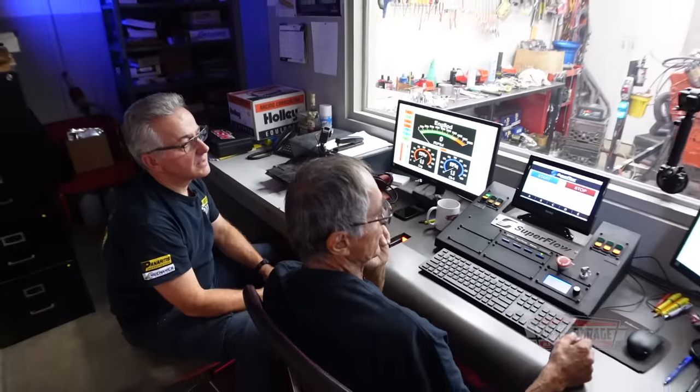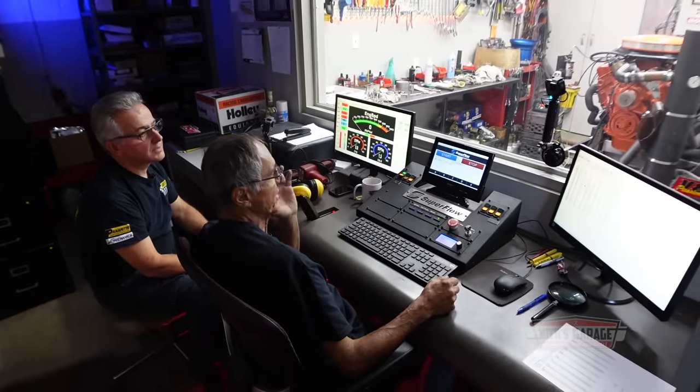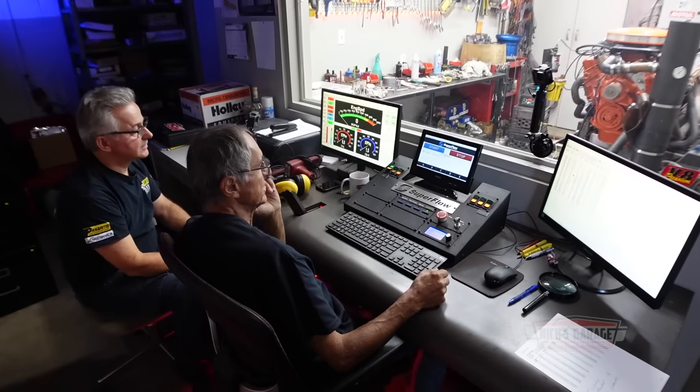And then we have the horsepower. By putting on that air cleaner, we're restricting it, right? Yes, we are. So all things considered, you got your air fuel mixture back. I got the air fuel ratio in the low 13s, but I prefer the high 12s. But I'm going to leave it at that because I might go with manifolds on this. Exactly. I'd like to see a little bit higher torque with the air cleaner the way it is. We can't stack them.